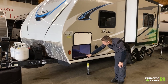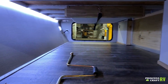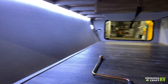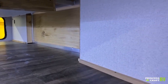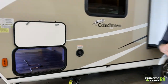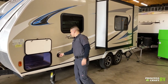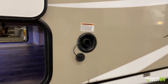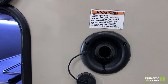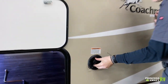There's a large pass-through storage compartment here. From a maintenance standpoint there's nothing you're going to be doing in here — it is just a large pass-through storage compartment. We'll find some switches on the other side to control the lights in the compartment and the lights up front. Here on the driver side we have your potable water fill. To fill that onboard water tank, you're going to stick a garden hose directly in there and fill it up. Once it overflows, that's your telltale sign that it is full.